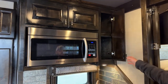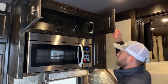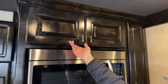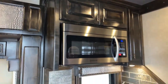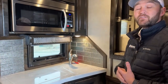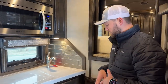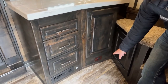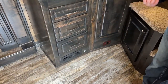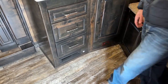There's a spice cabinet to the right of the microwave, and more storage up high. The customer added something worth pointing out — they're traveling in winter months a lot, so they wanted adequate heat. All the heat in this trailer is ducted through the roof, but they also ducted their furnaces underneath their cabinets where all the plumbing is. So anywhere there's plumbing, the furnace will run air underneath those cabinets and keep the plumbing nice and warm. That's a really cool option we can do.